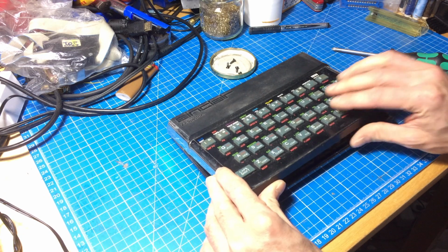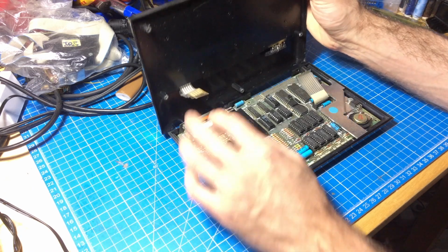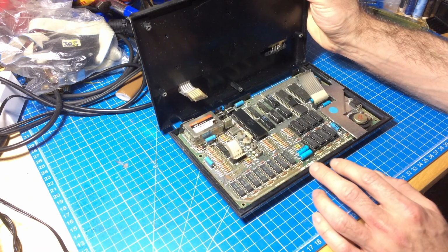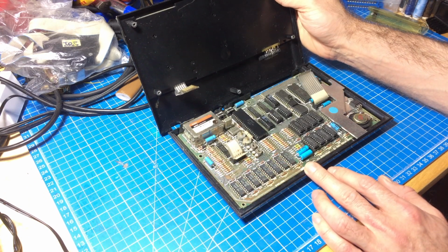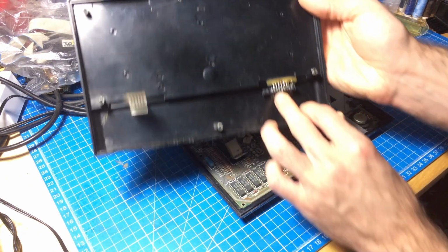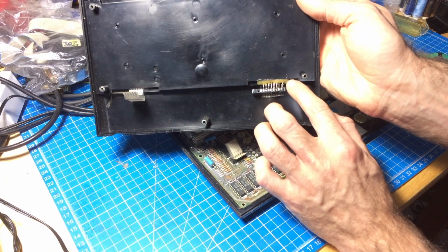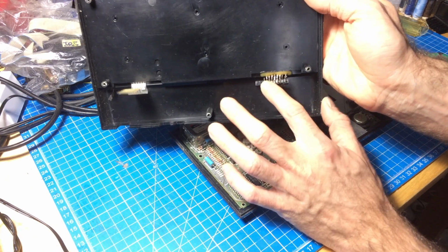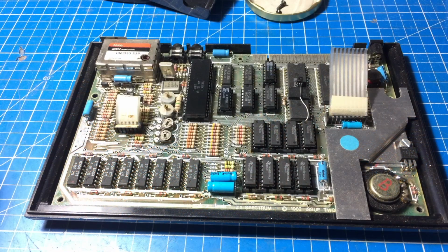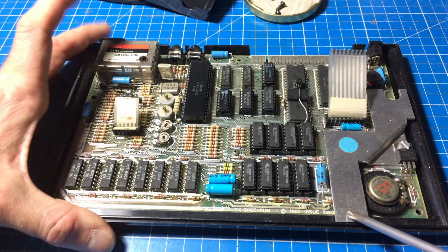I think there was one screw missing and, well, okay, the keyboard connectors just instantly cracked off. Okay, wow. There have been some mods here. I think the keyboard connector was repaired before with some epoxy and another connector soldered on here that the ribbon was put into. Okay, and it appears to be an issue 2 board, which is written here, 2.